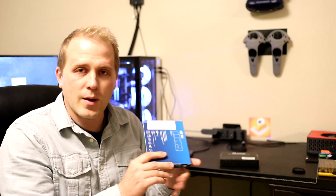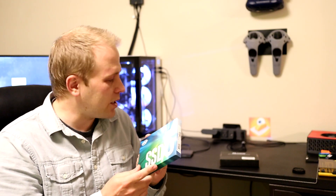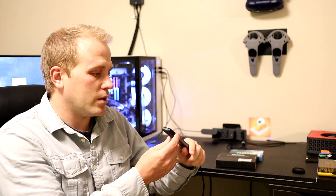This here is a two terabyte NVMe drive — the 660p. Now I know this is like one of the slowest NVMe drives, but the two terabyte version actually does have quite a bit of SLC cache in it, which might help speed things along. Its bursting should be pretty quick, so we'll see how well that goes and if it can beat the T3, which potentially it could.